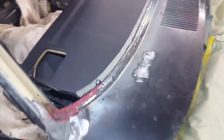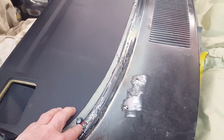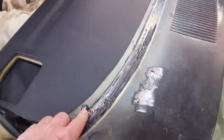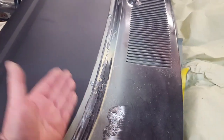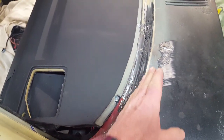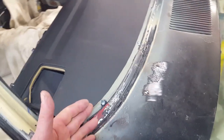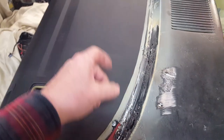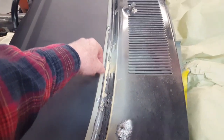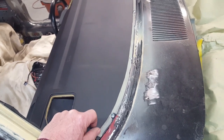I've cleared out the foam down to the bottom layer of plastic — the actual dash substructure — and screwed it down to the top where the windshield comes in at this angle. I've just back-beveled this for the time being; this will all have to be drawn back further because the way the rubber gasket comes in, it lays in this groove and then comes up flat over the top. In a regular stock 68 or 70 Charger, there are bolts that go straight down to secure the metal dash into the car — the only problem with that is you can't get the dashboard out without taking the windshield out.